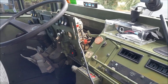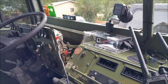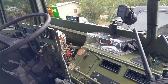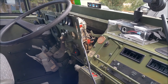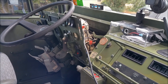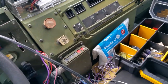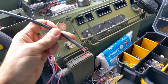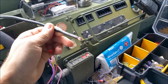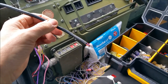I'm also going to put a switch in here to turn the remote start off rather than using the pin switch for the cab tilt. Since only myself and maybe one other person would ever work on this rig, it'll be simple to turn on and off using that switch. I've got the three harnesses in here — I need to connect the parking light output and brake kill switch, which will go over to the relay panel, and then we'll do a little test.